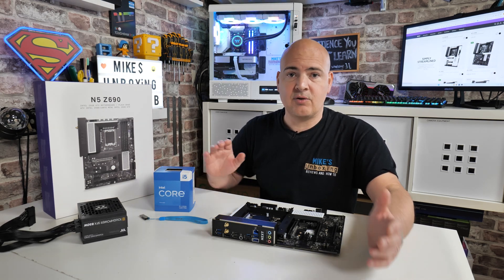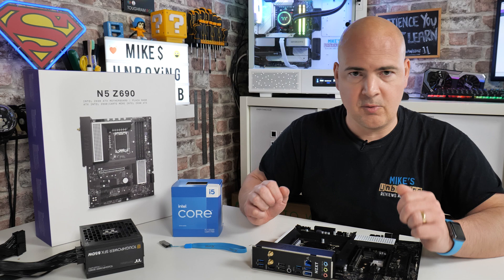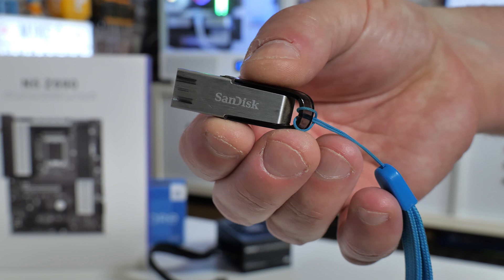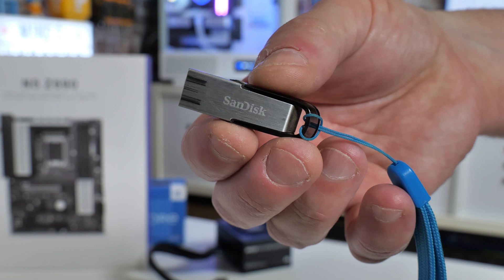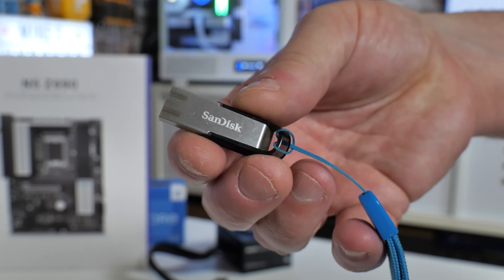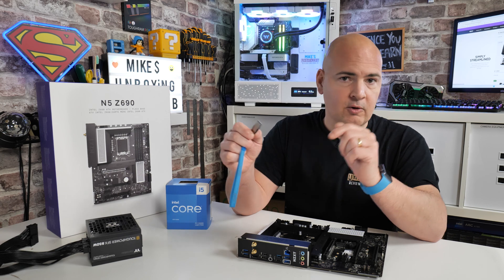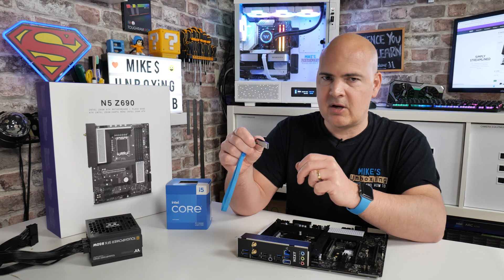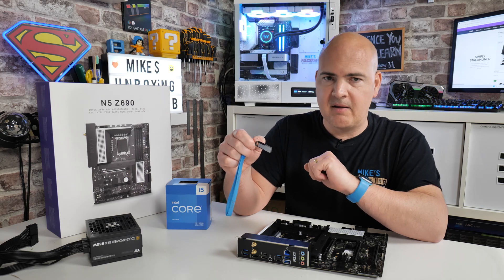The first thing to do is we're going to need to flash the BIOS to update it so it's ready for this new CPU. In order to do that, there are some things you're going to need. You're going to need a PC which you can connect to the internet to download the BIOS files. You're also going to need a USB drive that you can format to FAT32, so ideally 32 gigabytes or less. You can potentially use larger drives — we have done a video on how to create a smaller logical partition on a USB drive, which I'll link in the description. In my experience, that doesn't always work as well, but your mileage may vary.